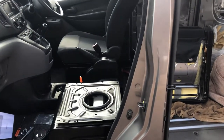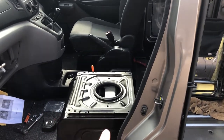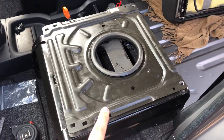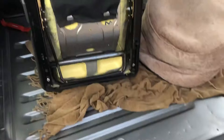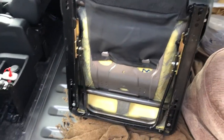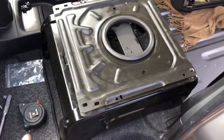Today we are turning the passenger seat into the captain's chair. This is a swivel plate for a Volkswagen T5, I believe. These are universal seat runners. In this vehicle, because it's a panel van, the passenger seat didn't come with seat runners.